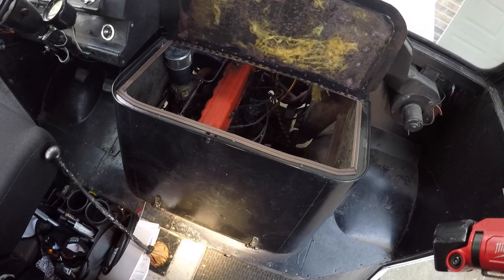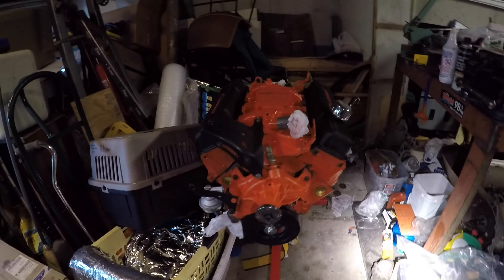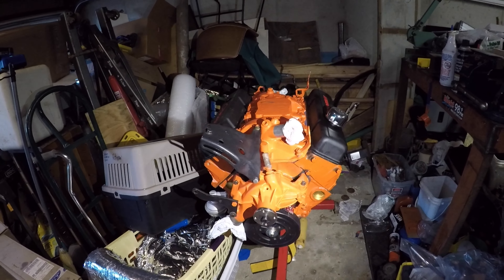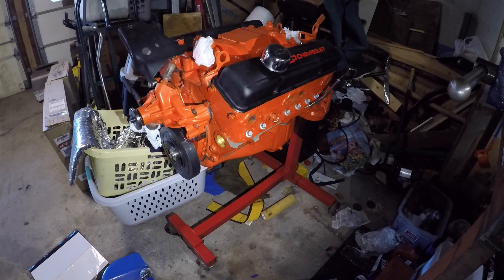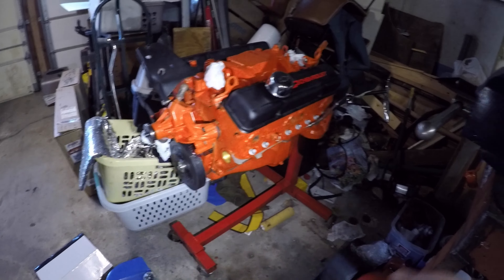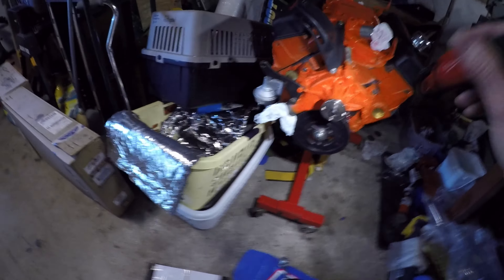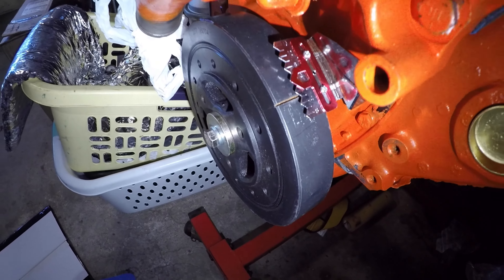So the new transmission — it's new, used. Let's go inside and take a look. Here's my V8. It's rebuilt, ready to go, everything's new, ready to rock and roll. I do have some stuff I have to do for the pulleys. I have a new flywheel for it. Right now it's set to number one top dead center, and I left everything set up ready to go. My mark is right there.